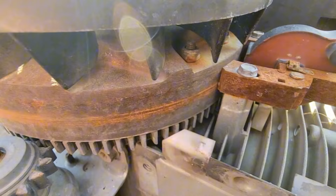Picked up this lawnmower for free. See, right now I'm trying to start it with a battery. And I think the starter solenoid doesn't work. So I've just been manually connecting this starter here. And you see, it actually turns over not too easily.